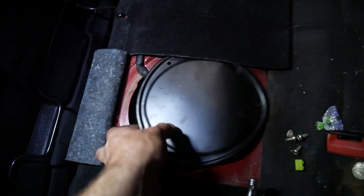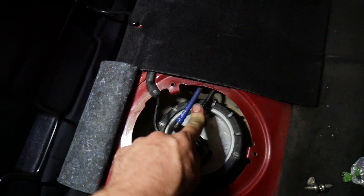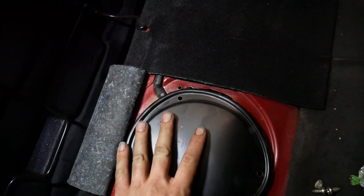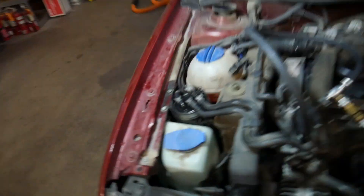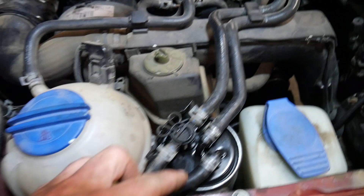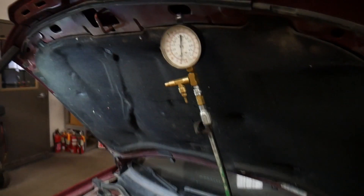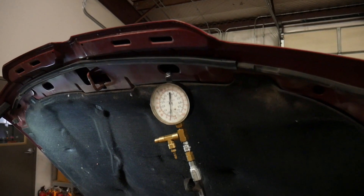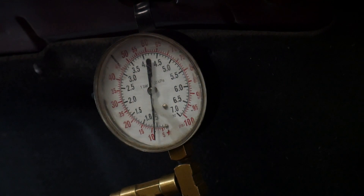Now that it fired up, we're going to crawl back here, lift up the cover, and make sure there's no leaks — there's only a tiny bit of diesel here, that's just from the lines. Don't see any leaks there. So now we can reinstall this, put the carpet back over, and fold the seats down. We also need to check the fuel filter — make sure there are no leaks up here on the lines. That all looks good. We're going to fire it back up and see what kind of pressure we maintain.